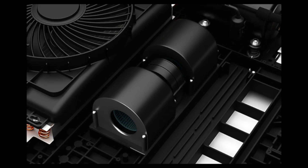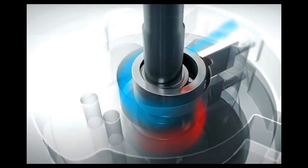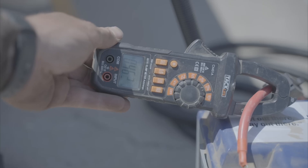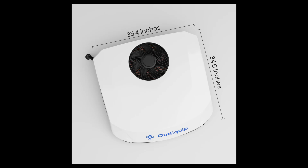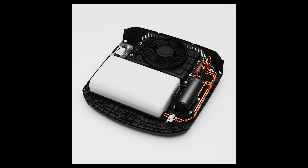Brushless DC fans on both ends give you strong airflow, stay quiet, and last longer. Same with the twin rotary compressor — it's quick, smooth, and efficient. On the 12-volt model, this system pulls anywhere from 22 to 62 amps depending on conditions, that's roughly 250 to 700 watts, and standby draw is only about 1 watt. The condenser uses multi-layer copper tubing — two layers in the 12-volt model — which improves heat transfer. The larger outdoor unit allows for an oversized evaporator, boosting overall performance by around 10%, and the sealed airbox with separate airflow paths cuts noise and smooths out airflow.